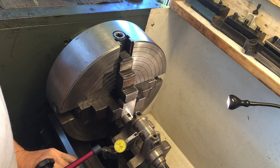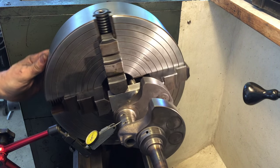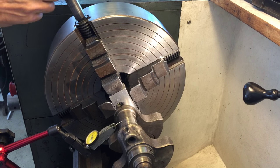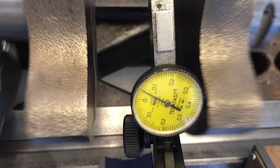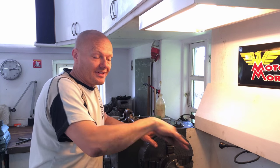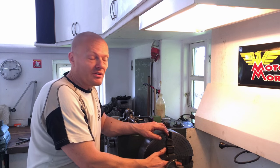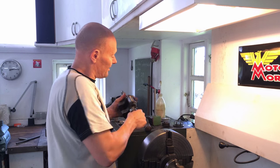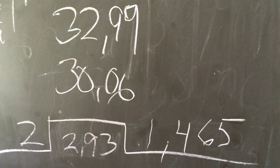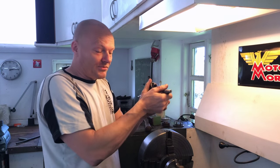For the mounting procedure, first I put in the crankshaft and made sure that the crankpin was running true. One should also make sure that the crankshaft is in line with the lathe bed, so you won't have any taper or crookedness to the crankpin. I do it like this: I take the large diameter and subtract the small one, divide it into two, and with two gauges I'm able to true it out.